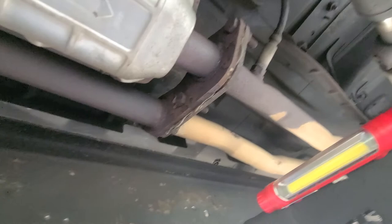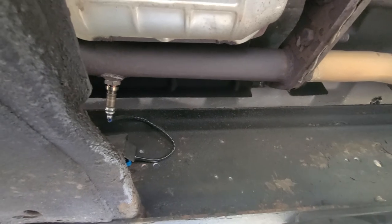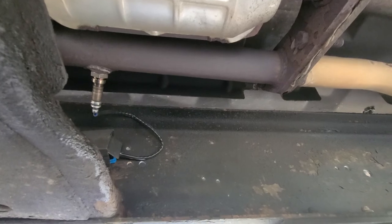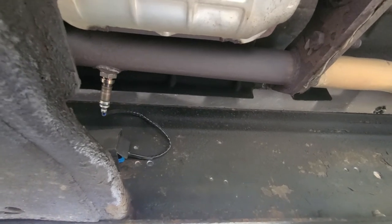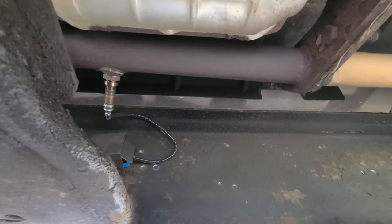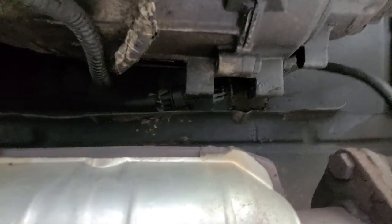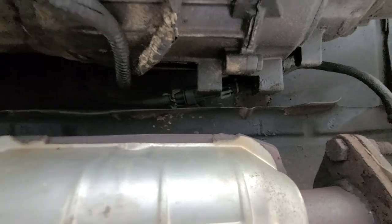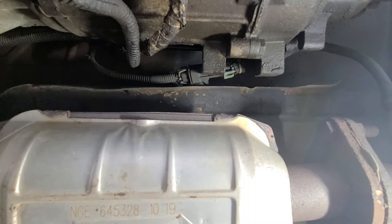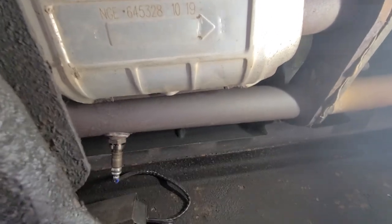That's how you do the O2 sensor swap — they're pretty easy in most cars, but some of them are in the weirdest places. If you've got a truck of this year, at least you know how to do each sensor, because they're all 7/8s and the plugs just plug in. O2 sensor two is right there — the plug is right up in there, which is going to kind of suck, but I'll get it. Until the next video, y'all have a good one.